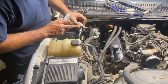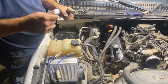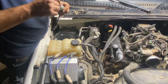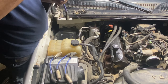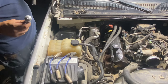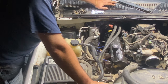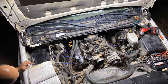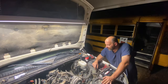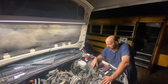Now I'm going to go to each one of these plug wires and put a dab of dielectric grease in there and put them on. I think I have an exhaust leak on number eight — imagine that. One of the reasons I'm putting dielectric grease in this time is because I'm going to Rendezvous in the Ozarks in a few weeks, and in Arkansas there are a lot of creek crossings — that little bit of grease will help from getting water in your spark plug boots. I'll grab a 13 millimeter socket and re-torque those manifold bolts real quick. Every one of the manifold bolts were loose.